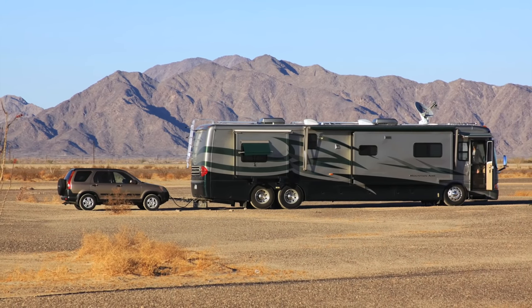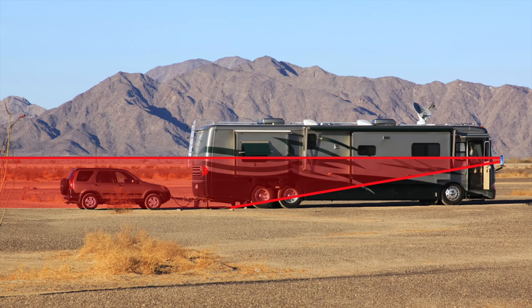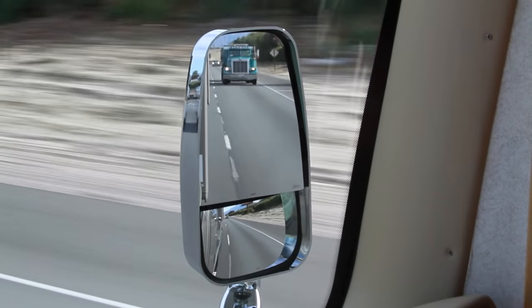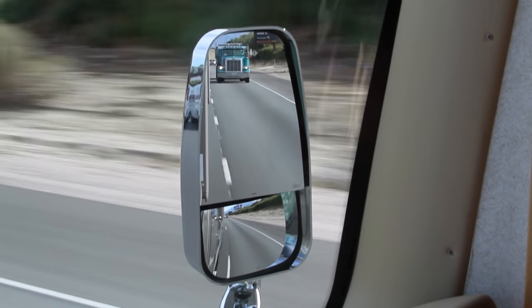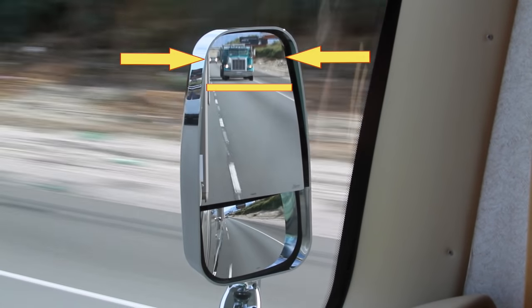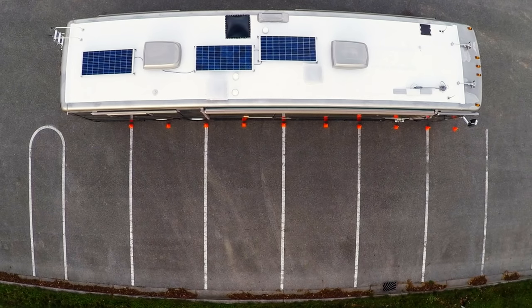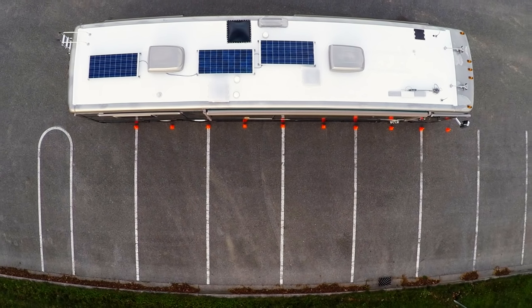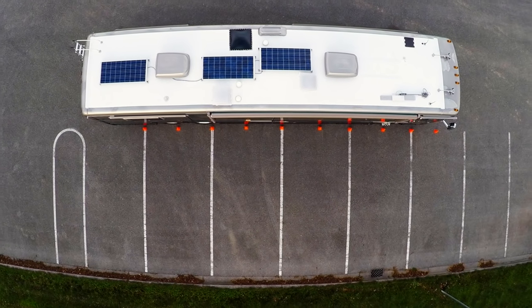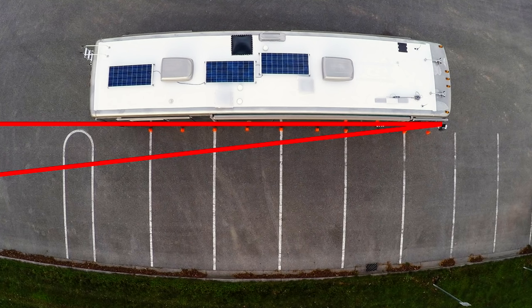Move the flat mirror up or down so that you can see as far off into the distance as possible in the upper portion of the glass. This will allow the viewing area to extend down to approximately the rear bumper. You should be able to see all the way to the horizon in the upper section, allowing us to see vehicles far off in the distance in the top one-quarter to one-third of the glass. The horizontal, or side-to-side adjustment, should be set so that the inside edge of the mirror — the side closest to the RV — just skims along the bodywork.